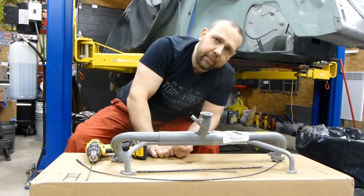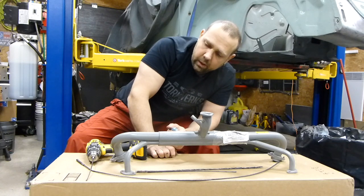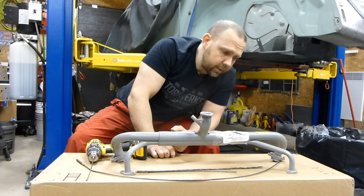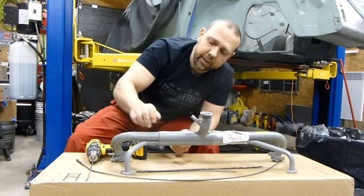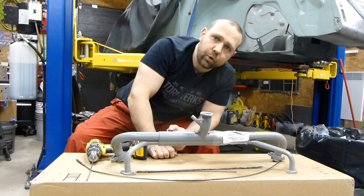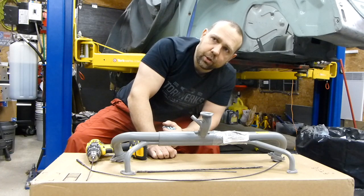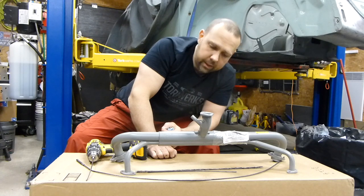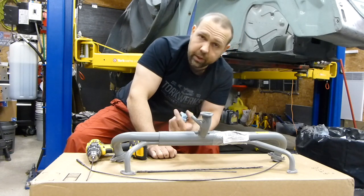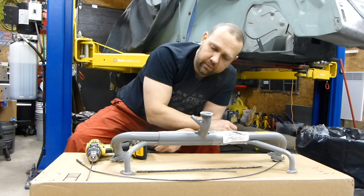Now let's go take a look at the same process I did in the car, where you can see some of the carbon actually flying out when I hit the air on the other side. Hopefully this gives you guys a hand to free up some of that carbon in those heat risers. It's something you definitely want to consider if the car is running poor as you're getting into spring and fall — just close to freezing, a couple degrees above freezing — when running your Volkswagen.